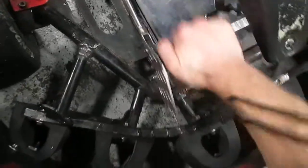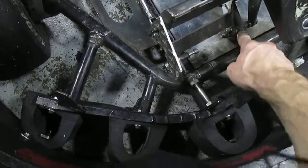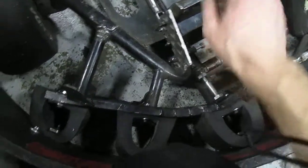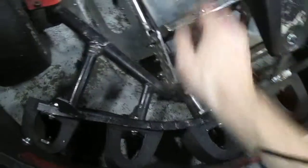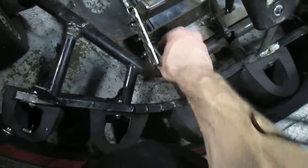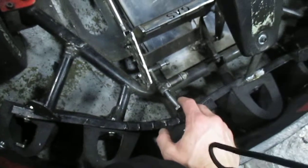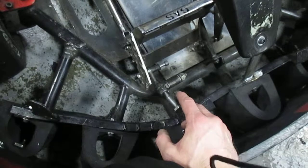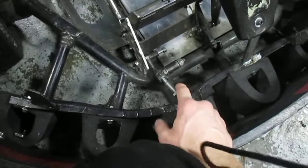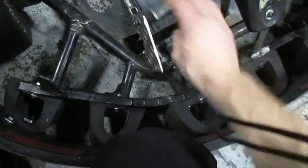The gas pedal is very simple — it just goes up and down like that. These two bolts down here are M8 bolts, and you use a 13mm wrench on them. Those are what stop the throttle pedal from going down in race kart mode. When you flip this over, this is what stops the pedal in sprint kart mode. So those two are completely separate for adjustments. If in race kart mode the kart does not have enough top speed and it peters out too early, these two need to be adjusted. If a kart is too fast or too slow in sprint kart mode, it's this one that needs to be adjusted — it just controls how far the pedal goes down.